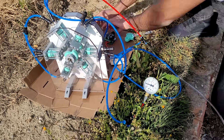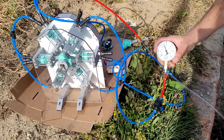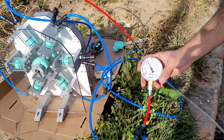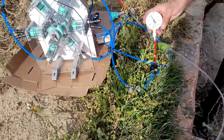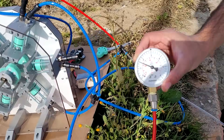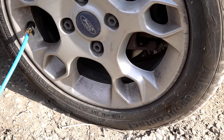Interestingly it takes much less time to pump up the tire compared to deflating it. I'm guessing the hose and the valve are too small so they limit the airflow. The pump is able to produce a lot of pressure momentarily and that pressure increases the flow rate. The gauge is not precise enough and it's a cheaper non-oil-filled type so it jumps up and down quite a bit. It was able to pump a single tire without rest, but the drivers got too hot to touch and the weather is quite cold — if it was summer I'm pretty sure some parts would melt.